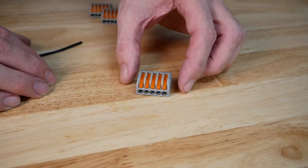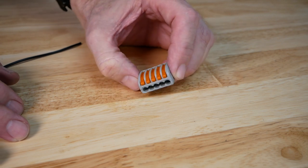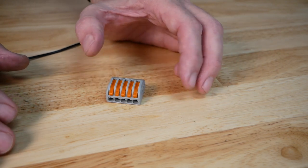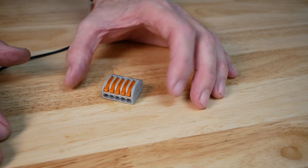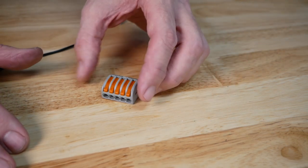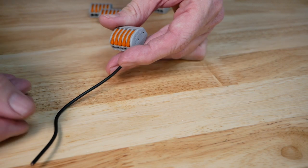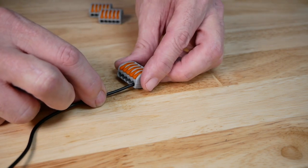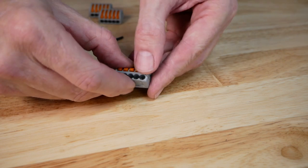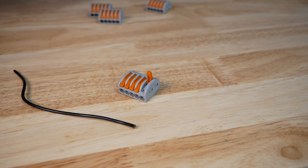I'm planning to use these WAGO connectors — W-A-G-O — and I've found these to be pretty reliable; I've used them on my 2012 Goldwing. What this is going to allow me to do is kind of extend the terminals on that isolator fuse block so I can add more items. The terminals are very small and it's very hard to get more than a couple of wires into them. My plan is to add one of these connectors to each terminal, so I'll run a wire to, for example, the brake light terminal, and then anything else that needs a brake light connection I can add into one of these ports.